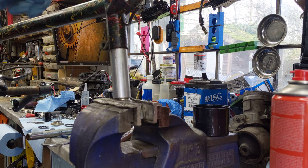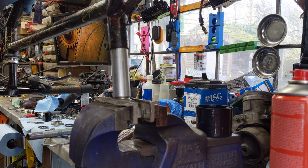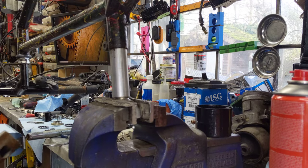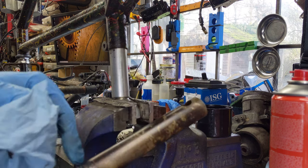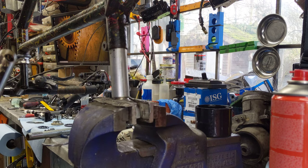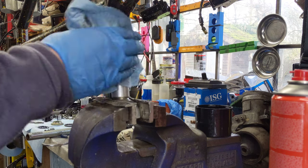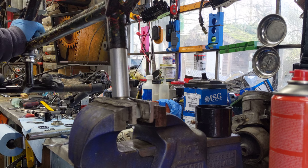This is filled up to that hole with evapo-rust, and it's been working since I inserted it last night around 11pm, filled it up — both of these. This is the only kind of non-destructive way that I've been able to get the posts out without snapping the head off or otherwise. You can see the surface area that was pitted or grabbed onto the Syncros post and the many attempts that were tried mechanically before I tried this stuff. There's a lot of corrosion on this frame that's hard to capture, and this is not a factory paint job either.